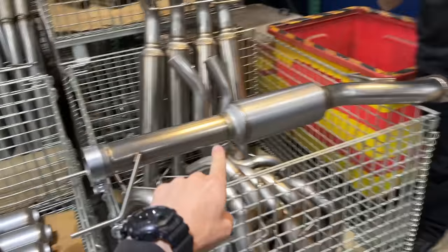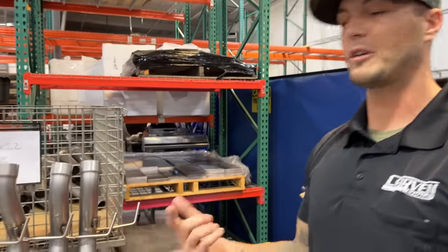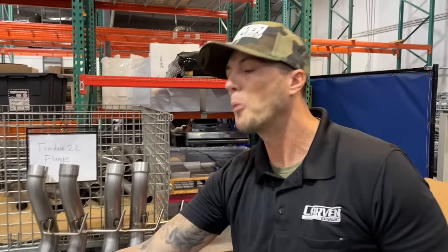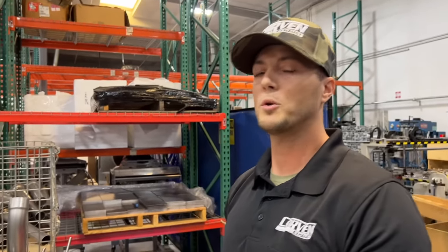What I'm doing is a cut and clamp. Yes. And we get a much smaller muffler with that. Let's go over why. I'm sure your followers will love this. With the cut and clamp, you retain your factory resonator, just replacing the muffler section alone. So when you have a muffler working in compound with a resonator, you're getting a 2-for-1 out of that exhaust. On one piece of tubing, you have two components combating the two necessary evils of exhaust: the sound and the drone.